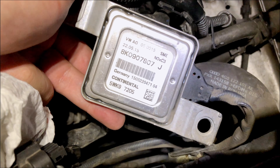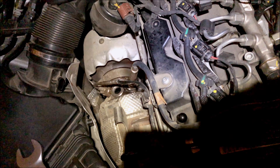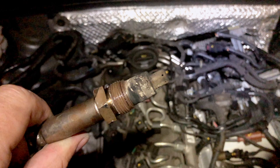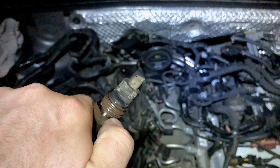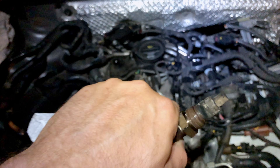So that's my sensor — you can see it's the J revision. I'll clamp it to hold it in place and unscrew it from the housing. Here's what it looks like: it's quite dirty. I can see some of the holes appear to even be closed. What I'll do is use an additive — up to the thread level only — it's a fuel system additive for cleaning valves.